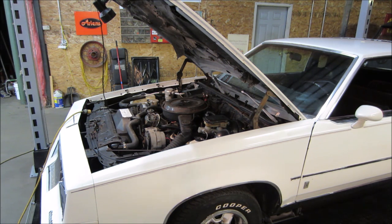And the one or two that don't drop out, those are going to be the cylinders that are suspect that are not firing. And then we can search into it: is the plug wire bad, or the plug? Does it have no compression in that cylinder? Is the cam not doing anything? And we can kind of go chase it further that way. So without further ado, we get you set up, get the car warmed up again, and see if we can figure that out.